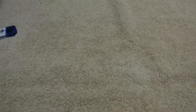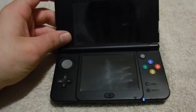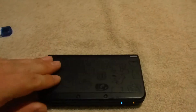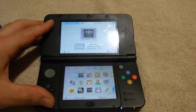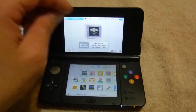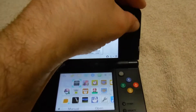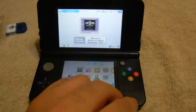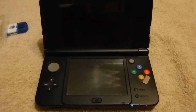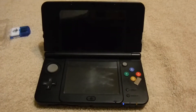So you have your 3DS, and let's turn it on here. You've probably put your 3DS into sleep mode before — you just close it and it goes to sleep, open it back up and it turns back on. What you might not know is that the thing that makes that happen is a magnet inside the system. There's a magnet right up here in the speaker — you can see that by taking this magnet and it sticks right there. So you take this little magnet, stick it right there, and as you can see the 3DS goes into sleep mode and stays in sleep mode as long as that magnet's there — just the same as closing the top of the system.